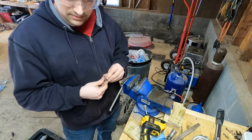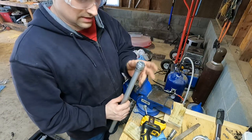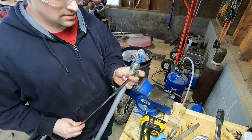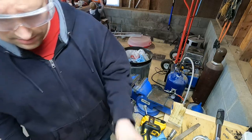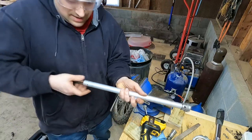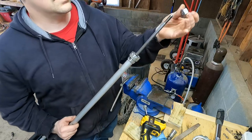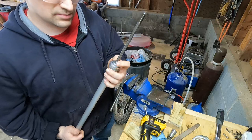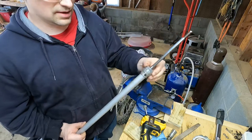Now the idea is this will fit in here like that with the damper rod — that's the nut off the damper rod. The damper rod will be sticking out of here like so, and then the metal pipe will be on here, and you'll be able to stick it over the top. There we go — perfect. So all we need to do is weld that metal pipe onto here so we can get a wrench on it and hold the damper rod.